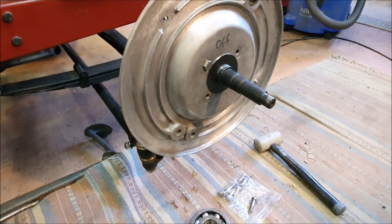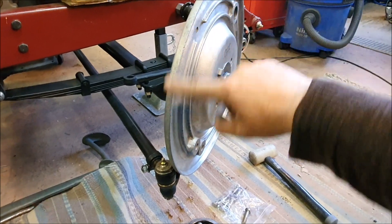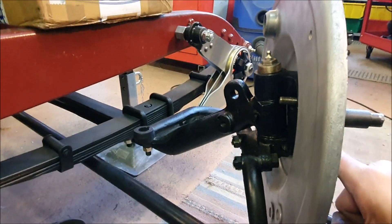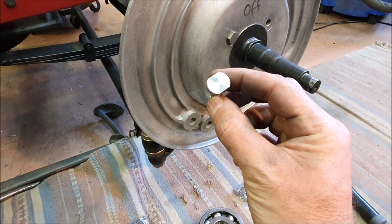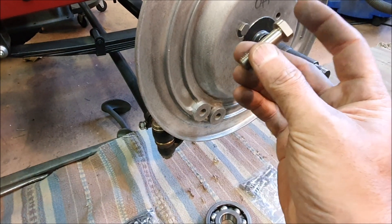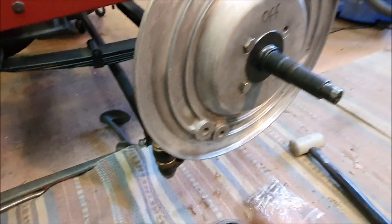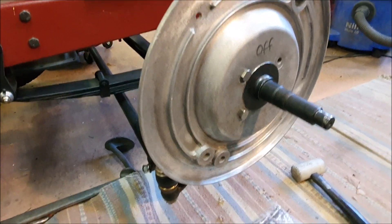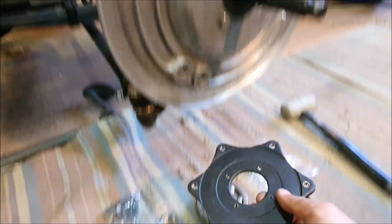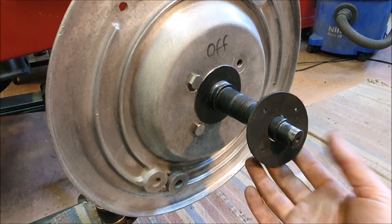I think I've got this figured out now. These are the brake back plates and they bolt onto the stub axles — and I'm pretty sure these are the special bolts that go through there to hold the back plate on. They have to be quite low profile because next you have the backing plate. The leather washers effectively seal around here to stop the grease coming out.